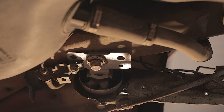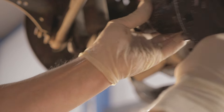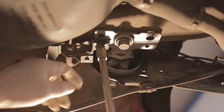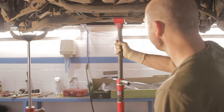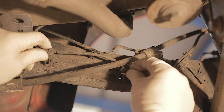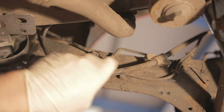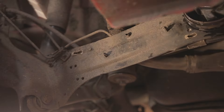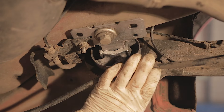Putting freeing oil on the threads of your bolts is always an advantage. Stick our bolt back in, tap that through, and then get it started on the threads. Stick them subframe bolts back into position and now just whack all the bolts up nice and tight. Don't forget the 13mm brake hose bracket. Refit your wiring loom, clip your brake pipe back into position both sides, and refit your two 7mm screws to hold your handbrake.